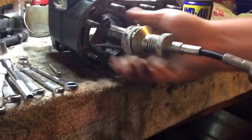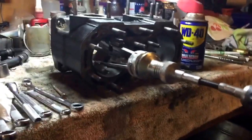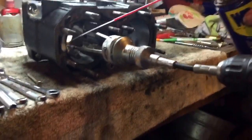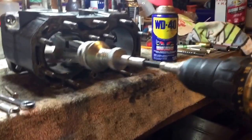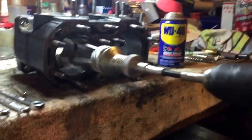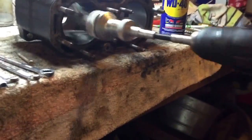As you can see, this one's got a light scratch in it, but that's a very light scratch — that's fine. You can hone that right out. People think you're taking a lot of material off the cylinder, but you're really not. What you're doing with these stones and the WD-40 is kind of like wet sanding — yes you're removing material, but at the same time you're polishing it and breaking all the nastiness off.